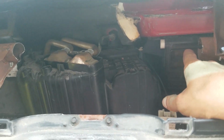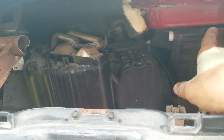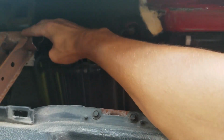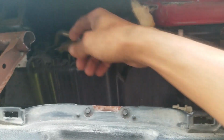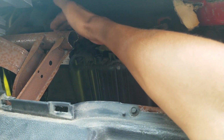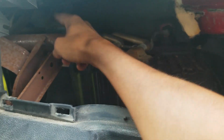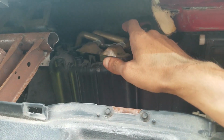So what I'm probably going to do is, like I said, I'm trying not to bolt it or not to weld it. I'm probably going to get a piece of angle iron, some thicker quarter inch stuff, and lay it across the top, remove this bolt right here, and overlap about 4 inches or so. Drill all the way through right here and here, maybe 6 inches, give or take, and put a nut and bolt, probably one this side, one that side. Maybe, who knows yet.